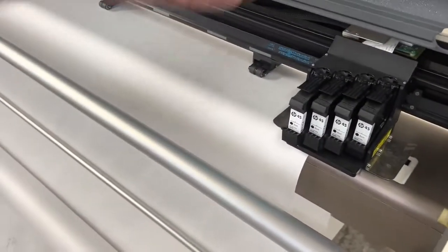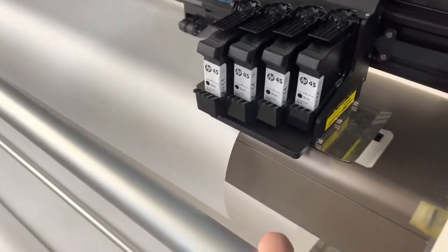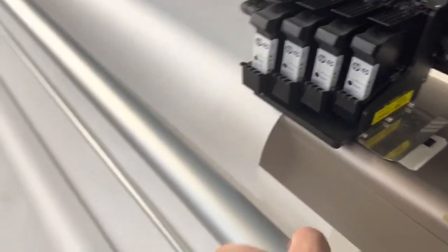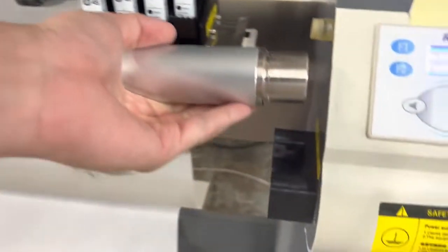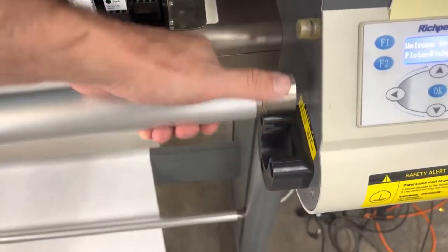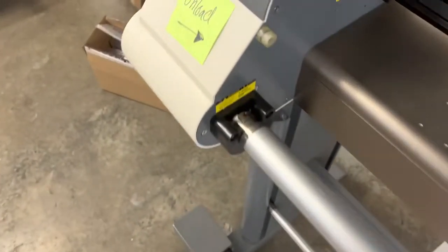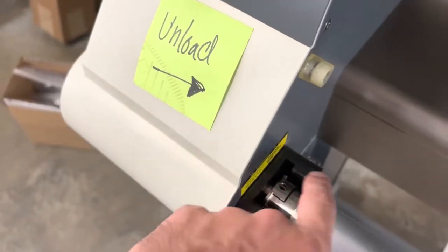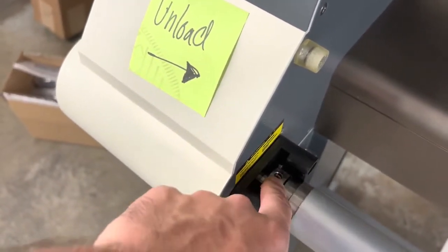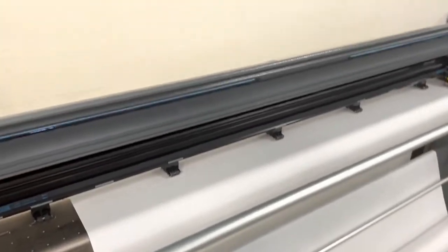When you're ready to take out your roll, one important thing is that you actually unload from left to right. You pop this bar out — there's a little slot here — take this out and slide the paper out that way. The reason is that over here they have these little hooks for the motor that will catch your paper, so you can't unload the other way. That's why I have a little reminder for myself to make sure I unload the correct direction so you don't get your paper stuck.